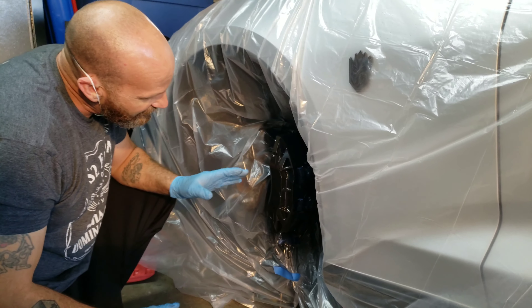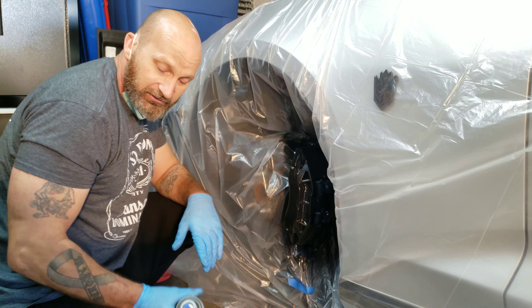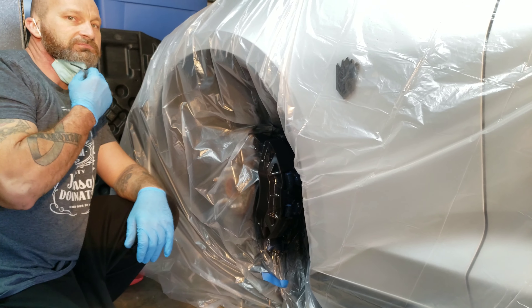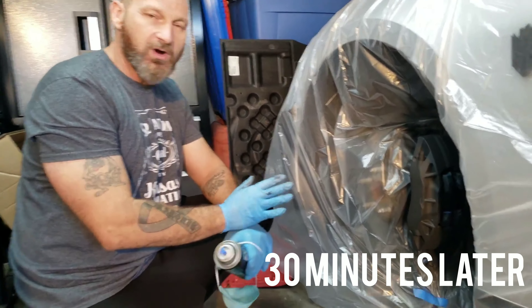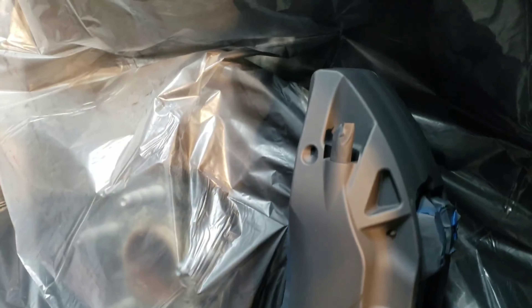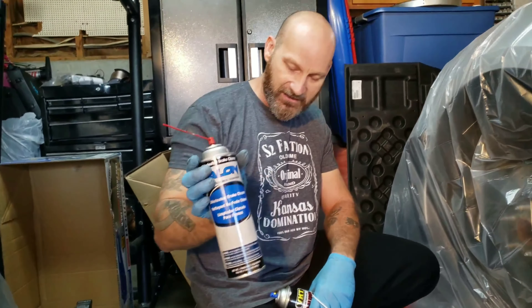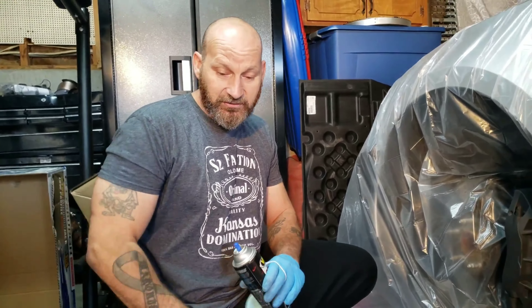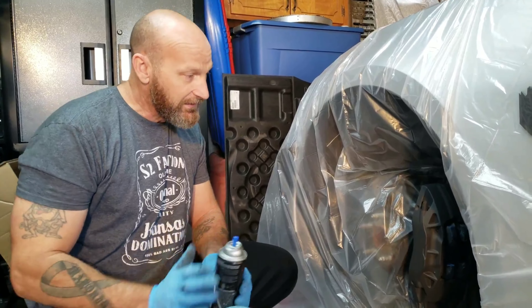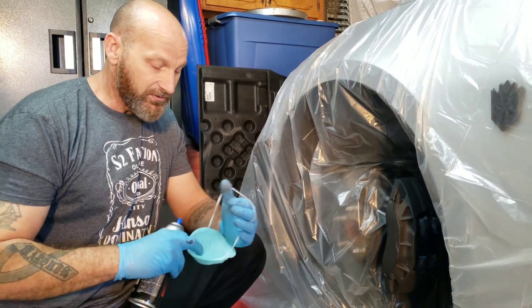He's showing you up close the primer. If it looks good then we're just going to go with that one coat; if not, we'll put another coat. We got done looking at it — one coat of the primer was perfect. You'll see it came out really nice, even coat — that's what we're looking for. Felt on it, still very smooth, good smooth surface. Make sure before you even start, get a good brake cleaner to knock it all off. If you feel over it and need to sand, go ahead and sand — these calipers here we didn't really need to sand.